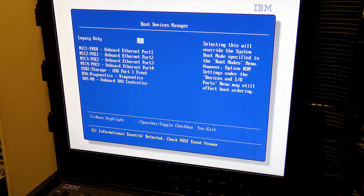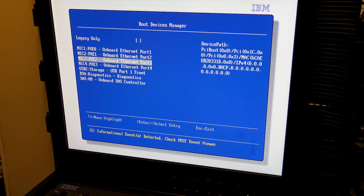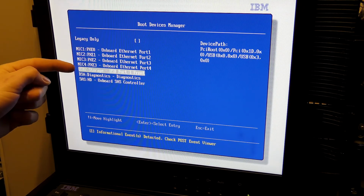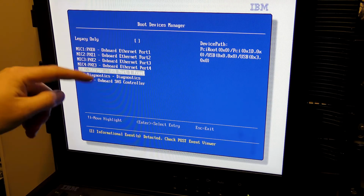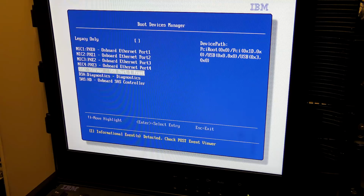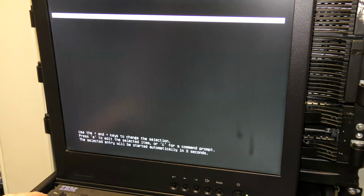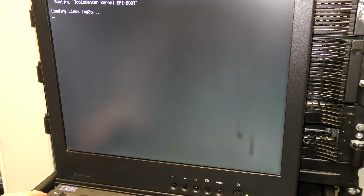I have to press boot order. I forget what it is. It's F12 for boot order. And it should see a USB 2 there on the front. Yep, that's the one we want. Right now it doesn't see the 10G network cards, but that might be okay. So, booting from USB. Yeah, it's doing a lot of stuff. It has seen a lot of new things come into the server, like 2 new power supplies, or at least 1 new power supply.